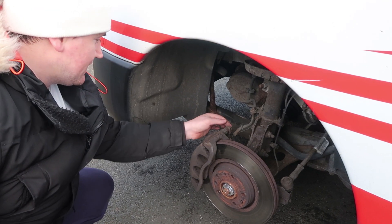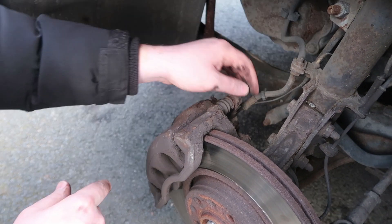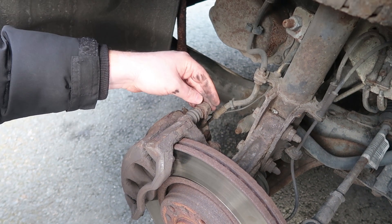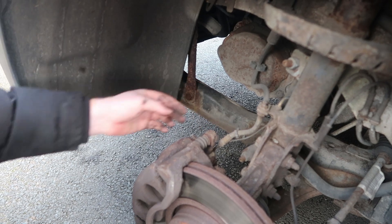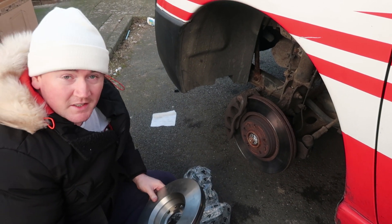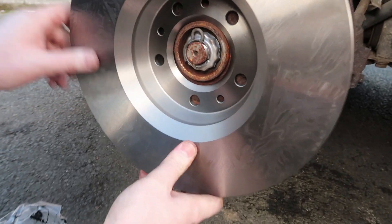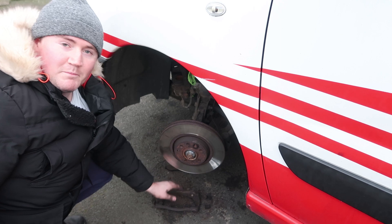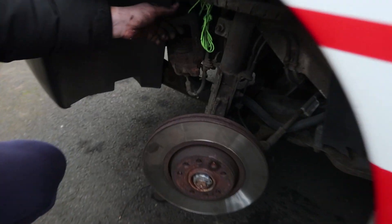We're going to figure out where the bad steering is coming from. These nuts and bolts here need to be tightened to 24.1 newton metres and these need to be tightened to 112 - I'm talking in torque, pound per foot. If you can get them to the correct torque, that's what matters. You want to make sure your brand new disc lines up with all the bolt holes - if it doesn't, you've been given the wrong size. A good thing to do is put it on the opposite way first and just check. All my holes match up, so I've managed to get the caliper off and the pads off as well.